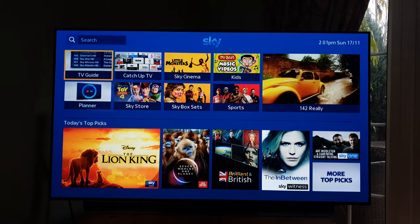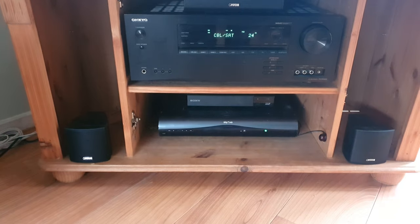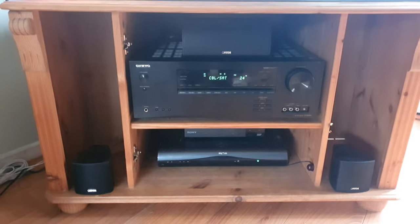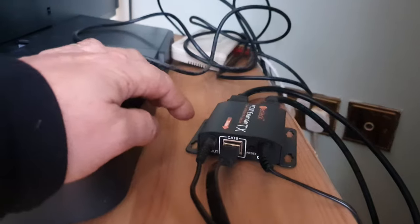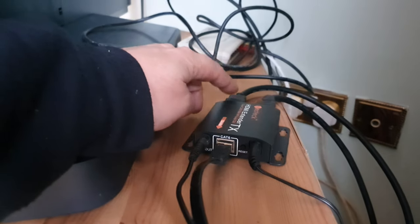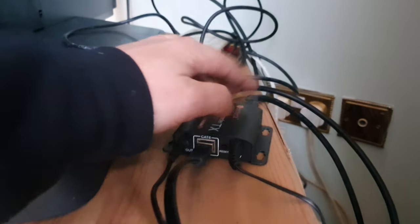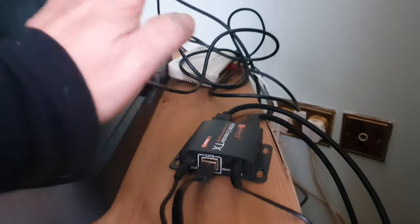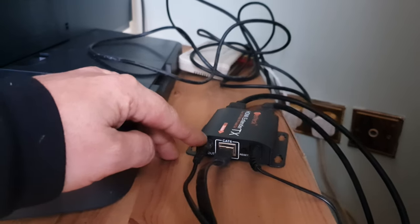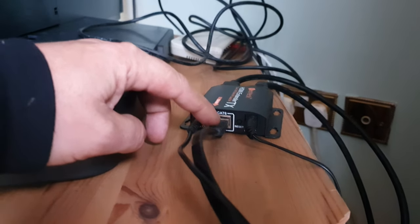So I'm downstairs and this is my new LG C9 OLED TV. More importantly, what we've got down here is my Sky HD box and receiver - this will work quite happily on Sky Q as well. Let's move around the back and see where the magic happens. What we've got here is the actual Neotech box itself, which is an HDMI splitter and signal sender via the LAN cable. You take your Sky output and input it into one end of the box, then HDMI output either into your receiver or into your TV, so everything functions as it normally would. We have a power cable, the IR blaster cable, and importantly this LAN cable connection - this is how the signal gets sent to the other location. You need to use CAT 6 or higher cable; I'm using CAT 7.